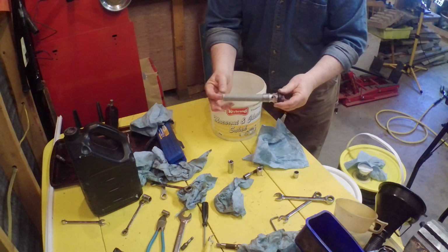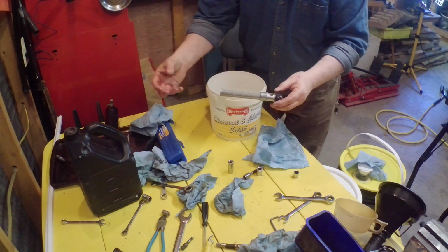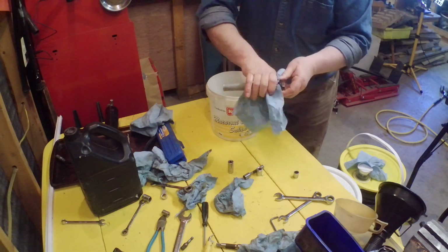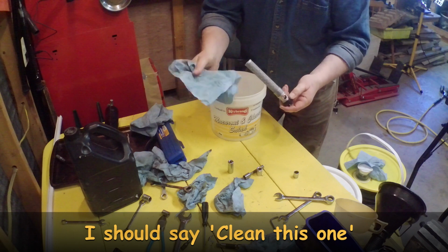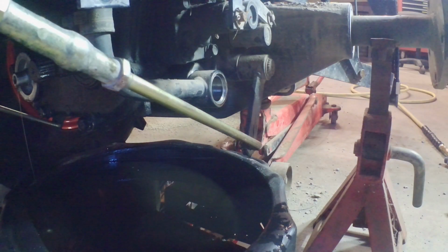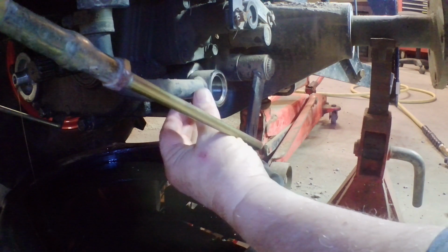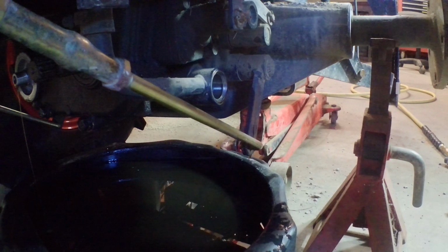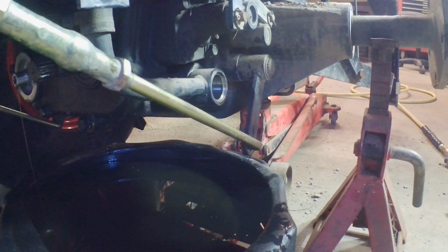It's right at the very bottom of the sump. All the oil gets sucked in through this before it's distributed around in the transmission. So this is critical that we change this one. So in this fitting, there's an O-ring on the back of it, and that seems to be in pretty good shape. So we're just going to set this back in place.